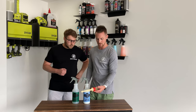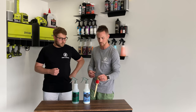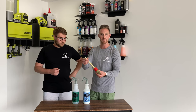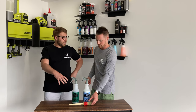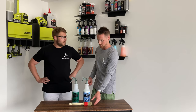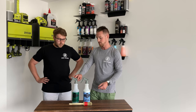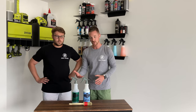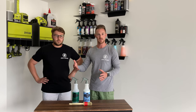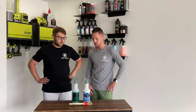We used the Race Glaze brush to clean most of the engine bay without using any mitts. The reason we use this is because you can get into all of the tight areas — it has a nice long handle so you can reach down into tighter spots. This product foams really well, so that combination is definitely good. This chemical is quite potent, so doing your engine bay outside first is probably a good way to do your detail. The reason we do the engine bay first is to make sure that any dressing in there has time to cure over the portion of the detail.